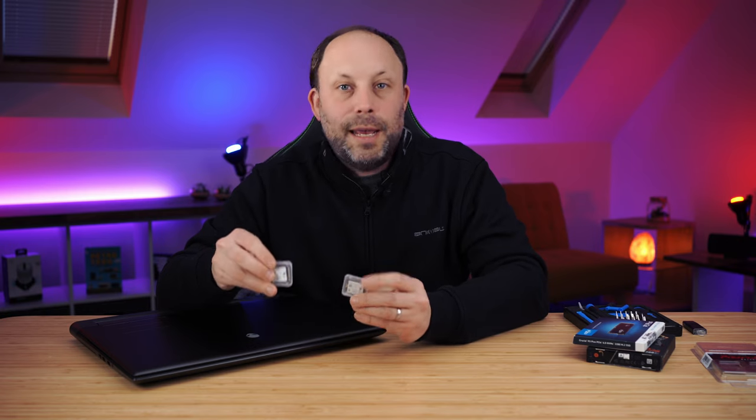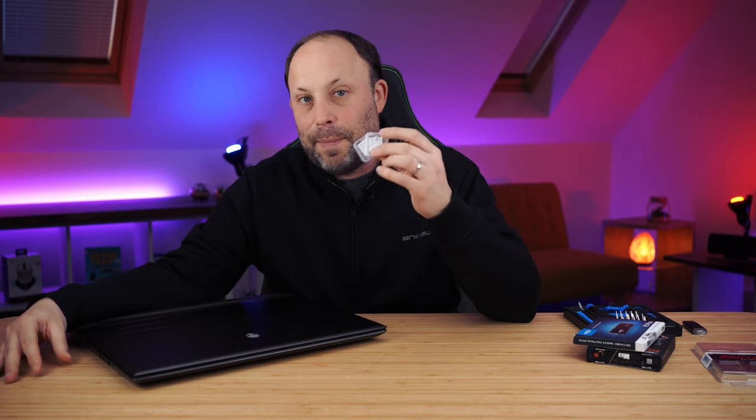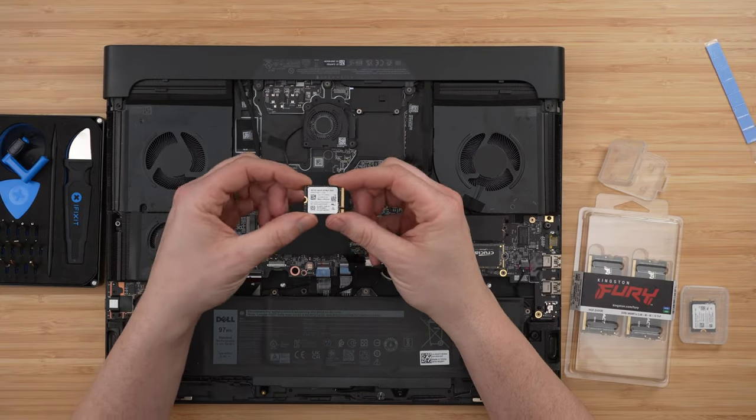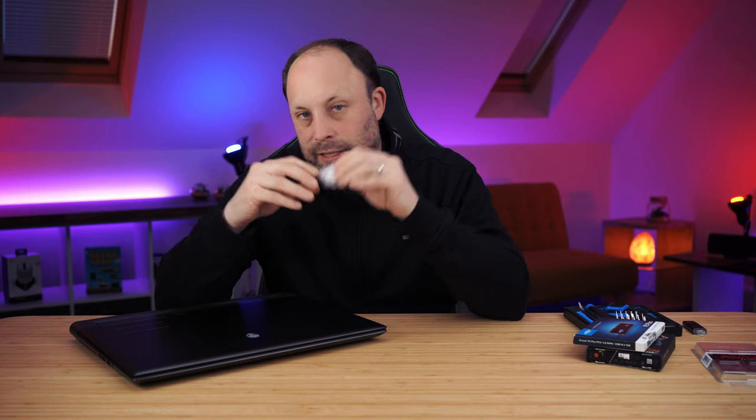Next I'm going to install my two M.2 2230 SSDs — these are the Western Digital SN740s. I'll put a link in the description below. These 30mm drives are very difficult to get hold of in the UK; I had to find some on eBay. If you're in America, the Sabrent equivalent is available on Amazon. There's nothing on UK Amazon unfortunately. These are working perfectly — install them into the 2230 slots and screw them down. Dell does provide the screws for all these SSDs, just not the heatsinks. All four drives are now populated.